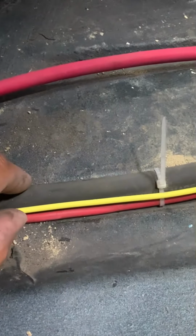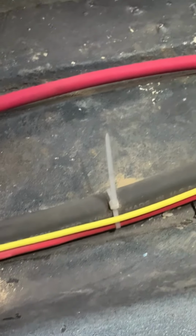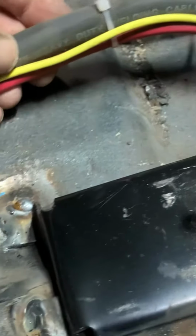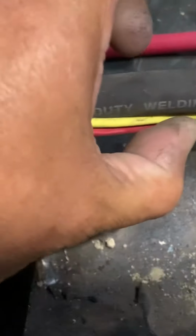And this is the wiring. It's going to be running back to the trunk. Here we've got a 4 gauge for the alternator. We've got a 12 gauge for the fuel pump. This 8 gauge right here will be for the fuse block on the firewall. And of course this is 2 gauge. See if I can find a spot on here where we can see it. I don't think I'm going to be able to find it, but either way, it says it's welding cable.